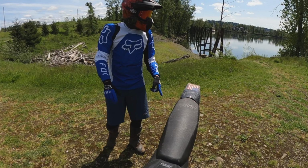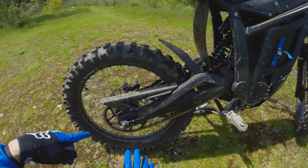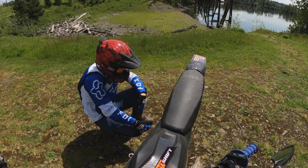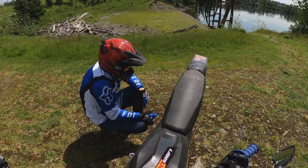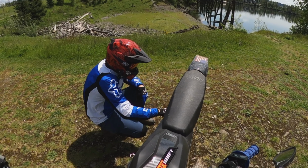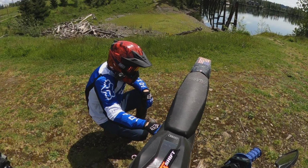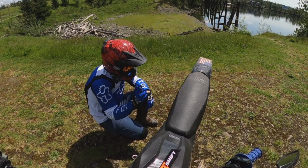So what I did is I dished this rear wheel. Dished, okay, not ditched it. Dish. This is so easy to do. I've kind of hemmed and hawed about it a little bit, and this morning I just woke up and I was like, you know what, I'm dishing the rear wheel. If it doesn't work, it doesn't work. It was so easy to do, and I almost went a little too far at the beginning, going 3 turns out originally. You don't need to do that. You can get about 1/4 inch to 3/8 of an inch offset just by doing 2 turns.